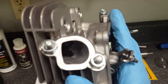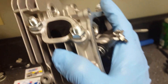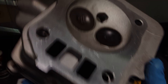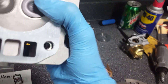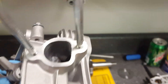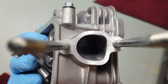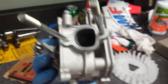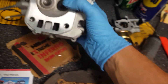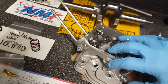I took my grinder and ported out the inside of the valve ports. Before, I couldn't get my finger from inside to stick out through where the valve is — now I can stick my finger all the way through with the valves out. I opened them up considerably and had a big pile of metal on the floor. Hopefully that will produce better airflow. I looked at images of what the stage 2 heads look like and tried to copy it myself. It's only a hundred-dollar engine, so it can only help.